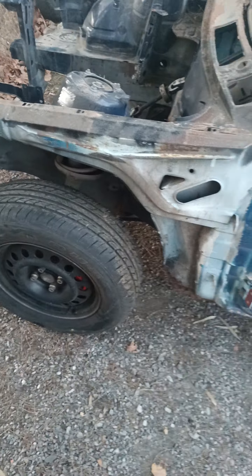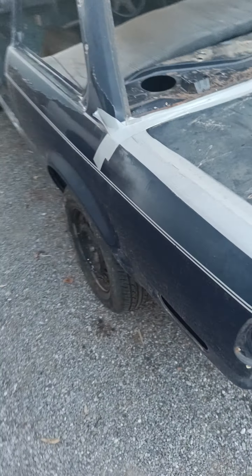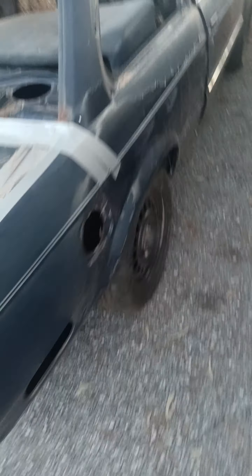This one's not bad except for this section which I actually have to weld in, but I think I'm going to cut this car up into appropriate pieces correctly. So that'll be quarter off here, spot weld drilled all the way through the sill panel, down all under the wheel arch, around through the boot, everything — and take them off properly.